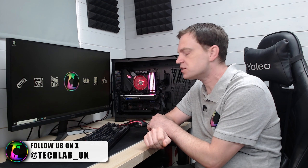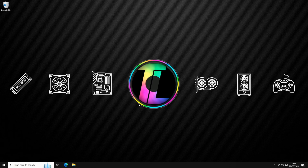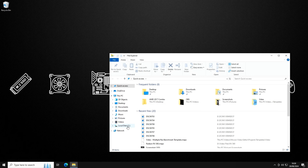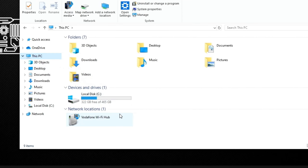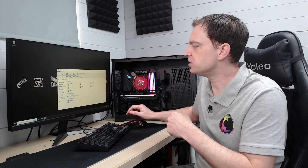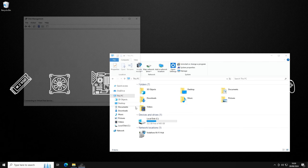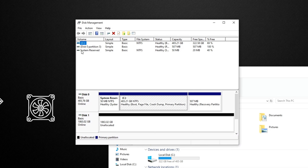With the expansion card installed, for those who have never installed a brand new drive before, there are a few things you need to do. If it's a used drive, Windows should auto-detect it. But for a brand new drive, if you go to 'This PC' you'll find the drive isn't present. The drive would have been detected in the BIOS — you can check there first. I can see one of the two-terabyte drives is registered. To get it showing in Windows, search for Disk Management and open 'Create and format hard disk partitions' — you'll see the different drives in your system.